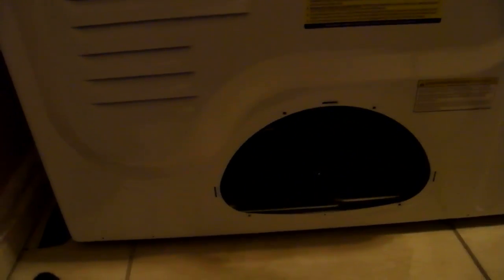This is one assembly, okay? You can pull it out, and if you look on the inside, I'm going to get my flashlight on. Flashlight, my assistant. My little Thomas, come on down here with me, son. Shine the flashlight inside the dryer. Now you can see straight ahead right there where that pipe was connected. You just carefully remove it from there, that's all. And there was a screw possibly located in this area right here, and I had to remove that.